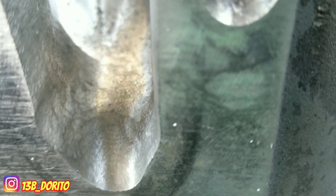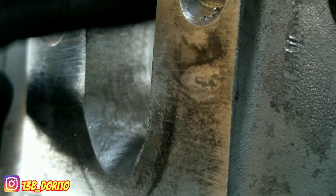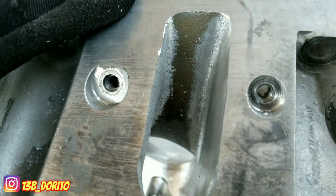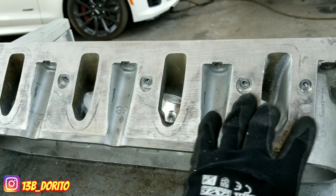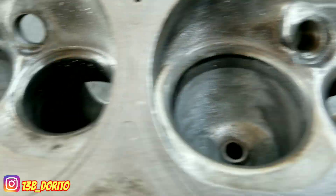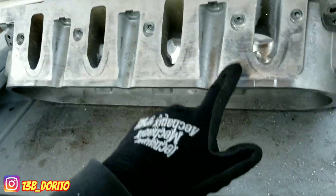This side is done, the roof is done. I just have to pass another one — a little bit less rough — and then we're going to do the floor, take all the little imperfections from there and make it smooth. Then we're good to go and can move to the next intake, and the next, and the next one. When they're all done, that's when we pass the sanding rolls inside of the bowl. So let me get the intake done and then we're going to move to the exhaust.